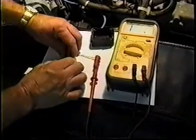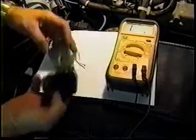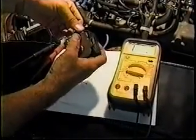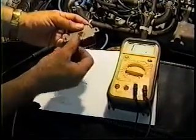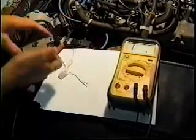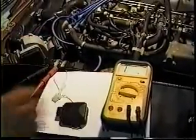So this switch is now good. Just for fun, what we're going to do — this switch on this car is already in place. This will just snap back on here. Start the ears and it locks in. There's a lock there, a lock there, and two down here — start the bottom end first and this last. Now, this has a half-moon cutout in it that holds onto the switch so that the shaft can rotate the center portion of it.